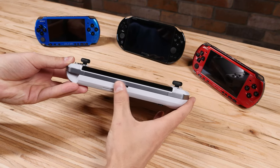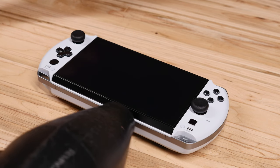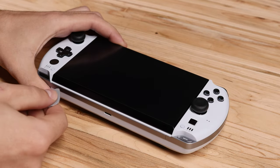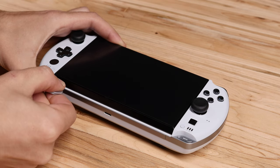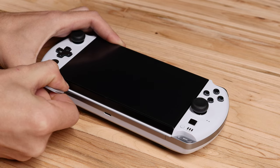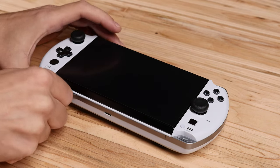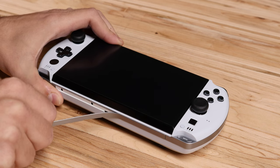The first thing to do is take a hairdryer to the bottom of the unit in order to remove the covered piece hiding two of the screws that let you get inside. You can try to pry this off without heating it first, however you risk damaging or even breaking the cover piece. GPD does include another one in the box just for this reason, but it's only one replacement and you may want to open the device more than once — for example, to do a firmware update on the display to get the proper refresh rate.